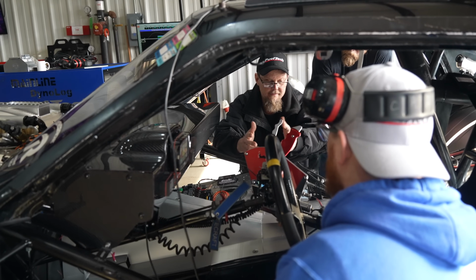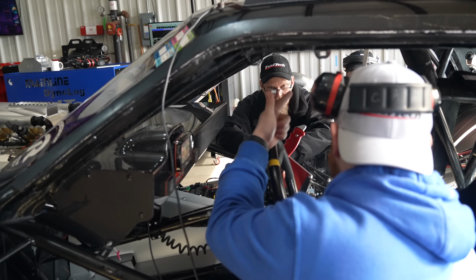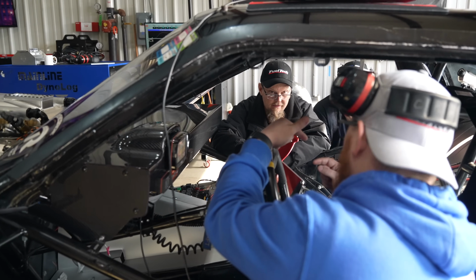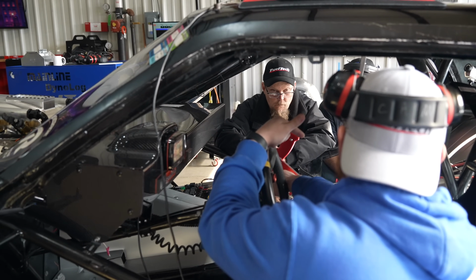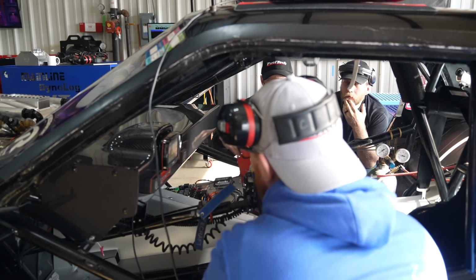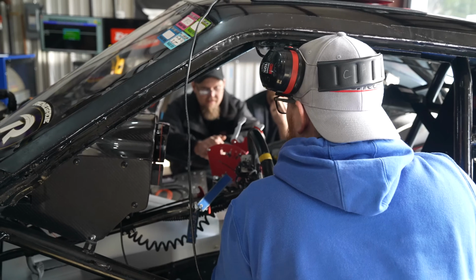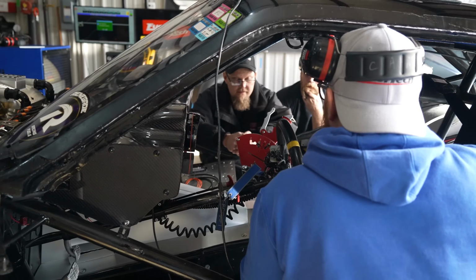Okay. The yellow outputs never shut off. They're either power or ground. And because they're either power or ground, that means they're also tied to the power circuit inside of the ECU. This has got power coming straight from the battery. Which means the power that's on that switch on your relay board there, that is constant hot, is going through your relays and keeping the ECU powered up. What I'm saying is, it's not hot. It's dead now. We just unplugged the yellow outputs and they shut off. Correct. So one of your yellow outputs has something that has constant power on the other side? The ECU. No. There's something coming from somewhere else.